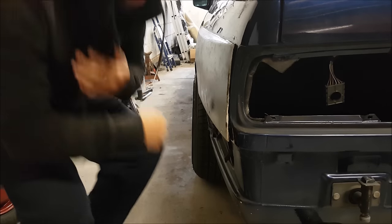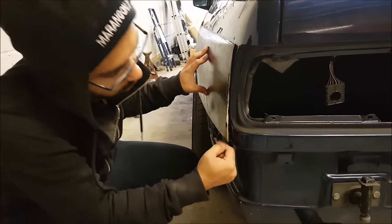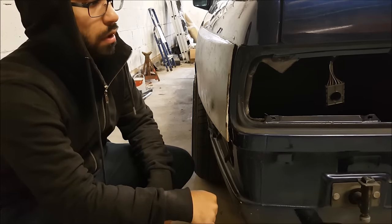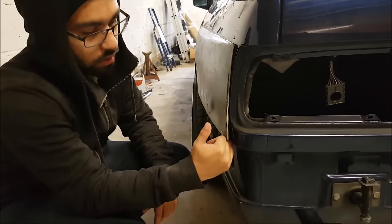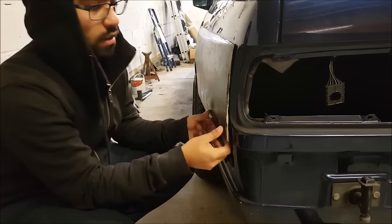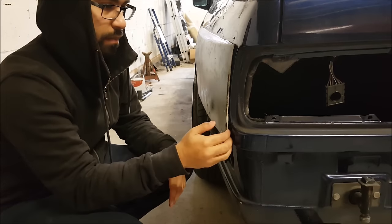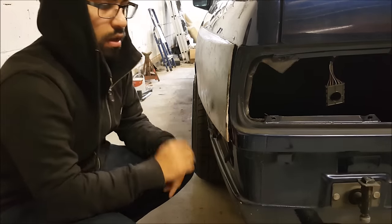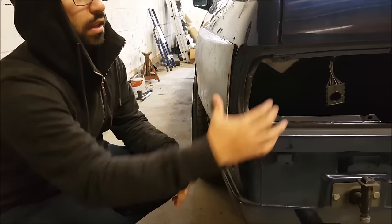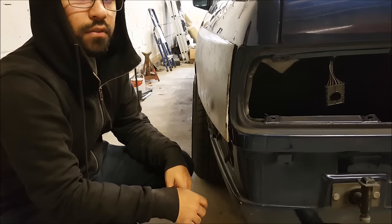One of the things I've noticed is that when I've gone to do the whole sealing, I've got a gap here and a gap on the bottom left corner. What I'm going to need to do now is cut that with the dremel where the tiger seal is, from wherever the gap starts. Then I'm going to look at pressing it together using some form of C-clamp to hook through and hold it in place. I wish I did that before, but hey, you learn from your mistakes.